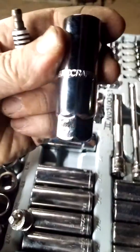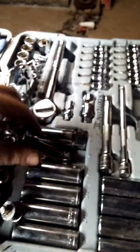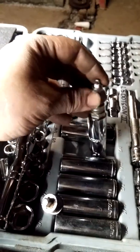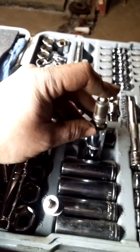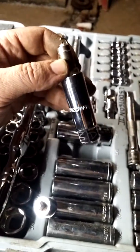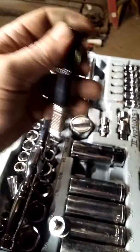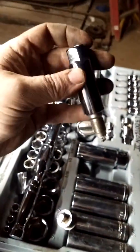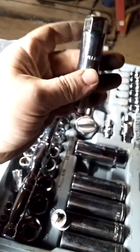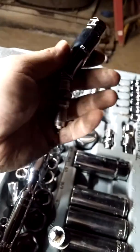And it's going to be this spark plug socket right here, which is a 5/8, and whenever you go down on this, your plug is going to actually go in this direction. It don't go in and then just start turning. You got to force it down till you feel that little rubber plunger on the inside there, that little rubber bushing. It's going to hold this spark plug socket in place. That way when you turn it out, it comes out and you just don't have to fight with it, try to stick a magnet in there and get it out some other way. You're going to want to use an actual spark plug socket to do this job, not a regular socket.